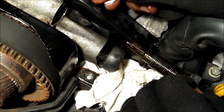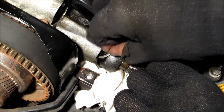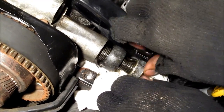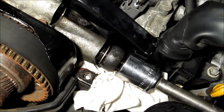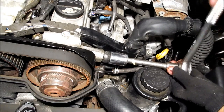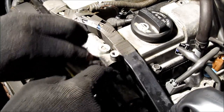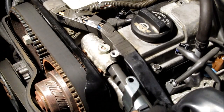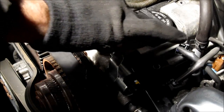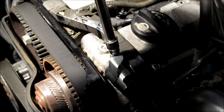The filter just slots onto the bolt, and then the bolt goes into the union bolt. I'm going to put the crush washer in here and then slide that in and tighten this up. Just going to snug down this filter. Now putting in the 10mm bolt that secures the oil line, and snugging up the union bolt. Before I insert the new oil control valve, I'm going to use a little bit of oil to wet the seal here to make it easier to insert. Then go ahead and insert the new valve, replace the 10mm bolt, and finally replace the electrical connector and tighten down the 10mm bolt.